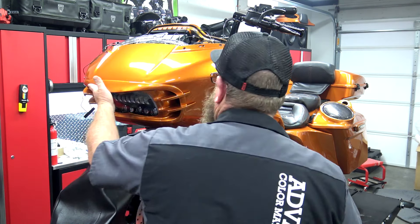The butterfly tapes tend to rip the first time that you take them off. You can salvage a couple of them, but usually you're going to end up ripping a couple of them. So any kind of tape will hold it in there — you don't see it. Electric tape, Gorilla tape, Tessa tape, whatever you want to use. Now if we come back down here to the blinker, we've got this bolt out. You're going to go ahead and pull it out, then pull this piece back towards you because it clips in here in the back. We're going to pull our wire out from inside here. Mine's aftermarket blinkers, so there's a little bit extra stuff on here that we have to deal with. Yours would just have this little Molex connector on the end. Then you just simply pull the blinker out of the outer fairing, just like that.